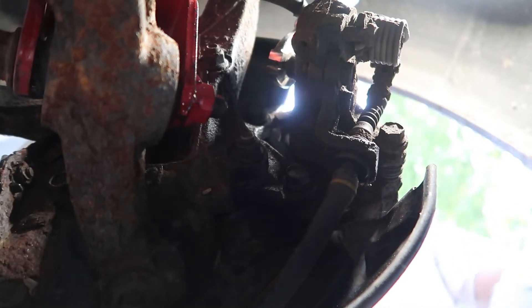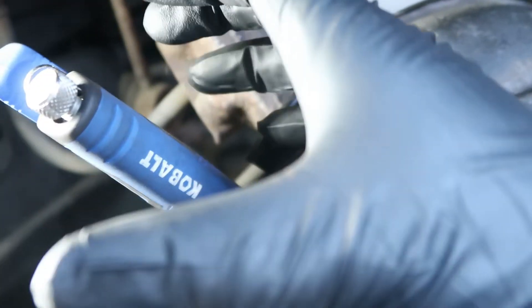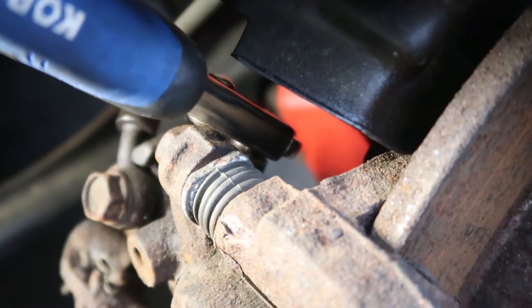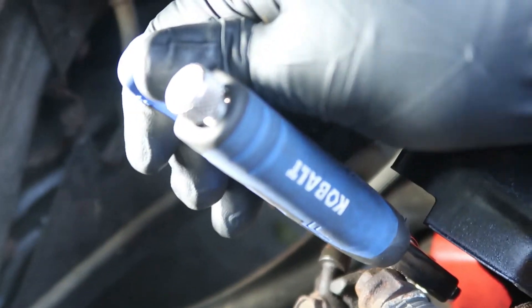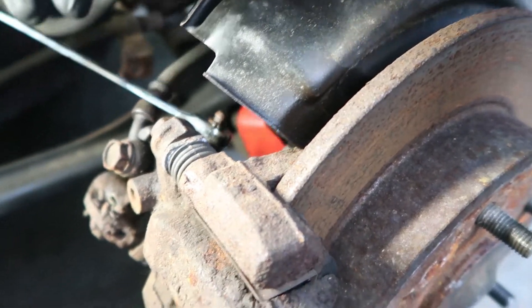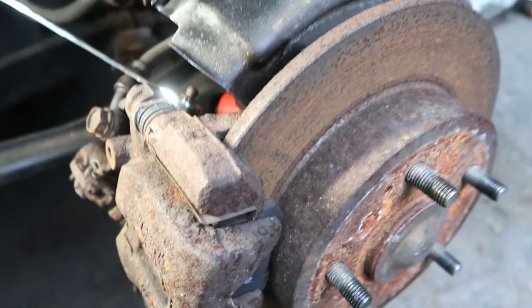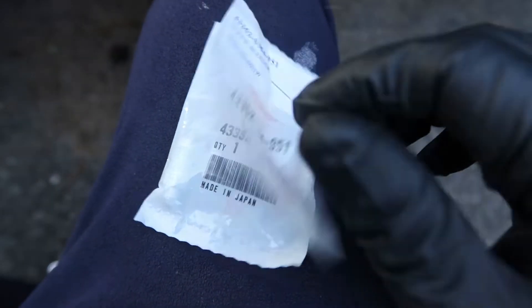There we go — it worked! I made these vice grips as tight as I could possibly make them. The way I do it is: make the vice grip as hard as you can, keep squeezing until you really can't squeeze anymore, back it out of thread, then squeeze again with all your might and those teeth will grab whatever's in there. That bolt is moving — it is moving! I can see the 10 millimeter is back on and she's moving. These babies did the trick. These are the actual Honda genuine part brake bleeders — I don't think it really matters, you can get generic ones and they'll work just fine.